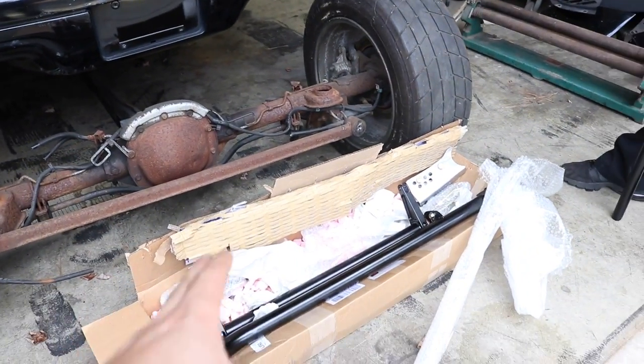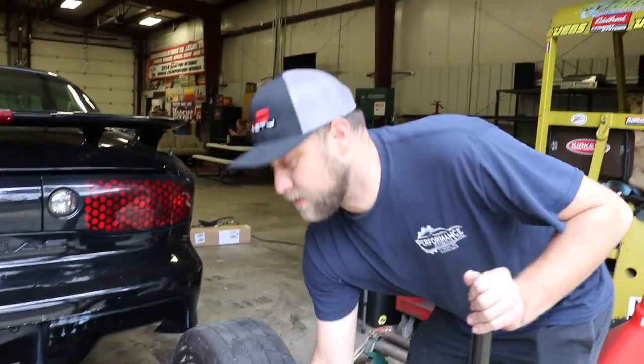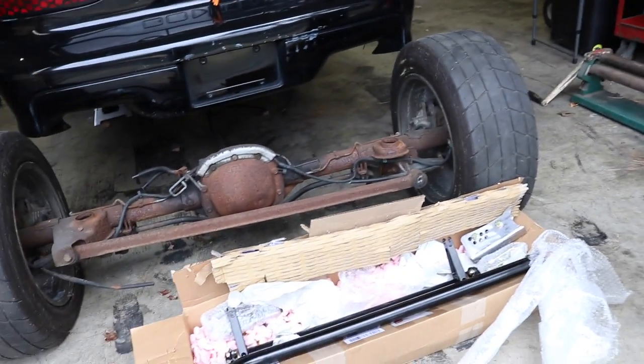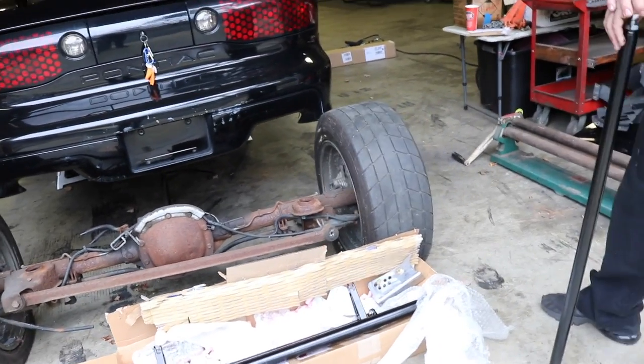I'm not an expert on anti-roll — you guys call it a roll controller. With this you can steer the car with the rear end. You can put preload in and out and add weight to the left front, which keeps you straighter on a wheel stand or launch. This is basically what we run in a pro mod, just a longer version. They've had cars run three-second passes with this exact kit, so it'll do everything I'm looking for, and it's simple — just a couple of bolts.